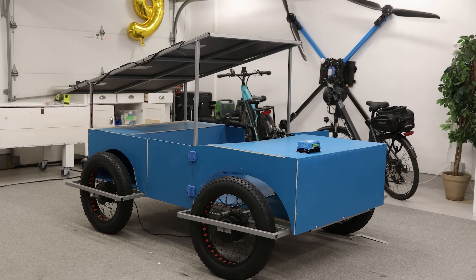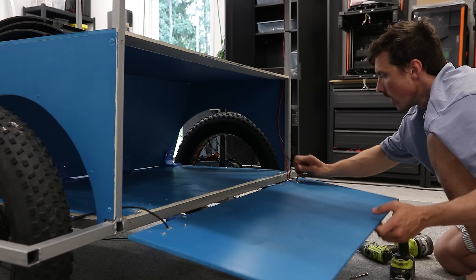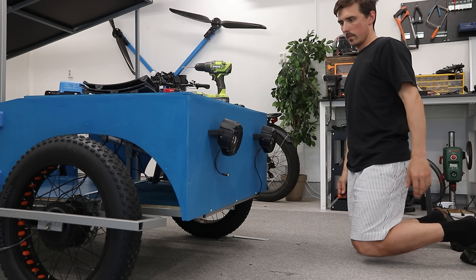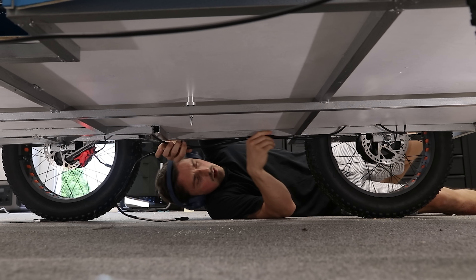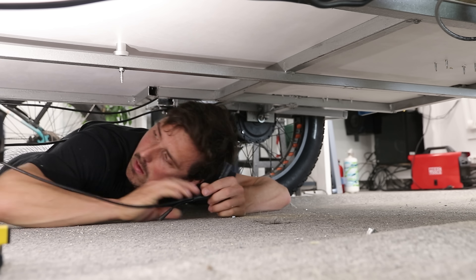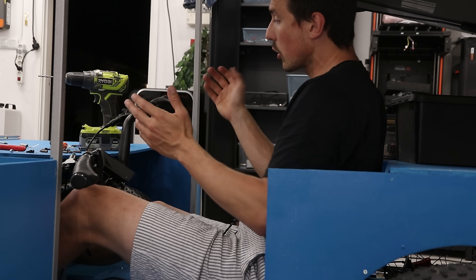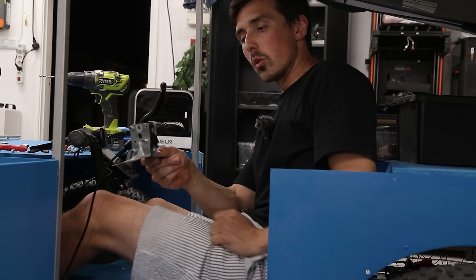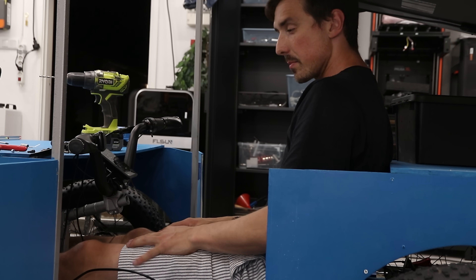I could go over it one last time with paint to cover up all the edges and salvage the final parts from the e-bikes — front and rear lights. I mounted magnets and 3D printed hinges on the rear panel acting as a trunk and a place to keep the electronics. Here are the four electronic speed controllers. The main motor cables were pretty short so I routed them under the car. Stacking two braking levers on top of each other — of course it didn't work. I couldn't grip my fingers around the two and actually brake comfortably. So the front brakes are now going to be simple foot braking pedals — four individual brake levers, a little unorthodox but that's how we're going to roll.